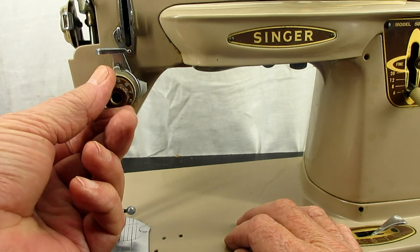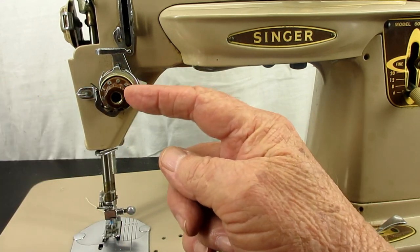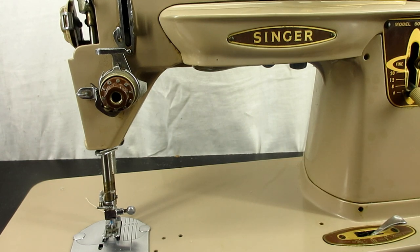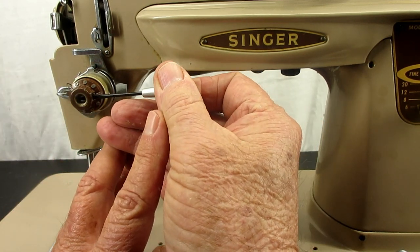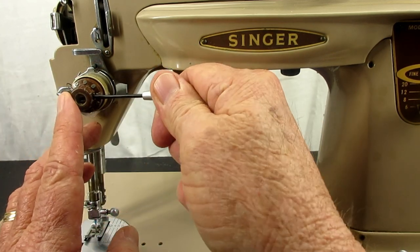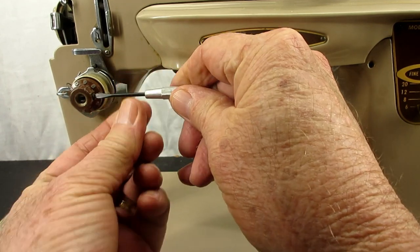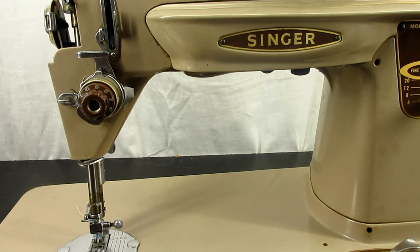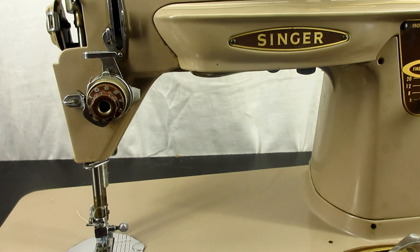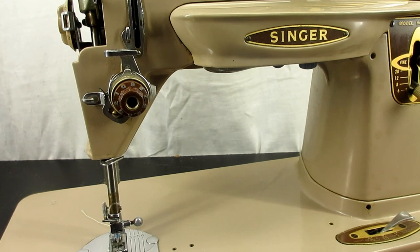If it's somewhere hard to get to, go ahead and turn the knob around until you find the little set screw. In my experience it's been at about three o'clock. Loosen it two or three turns — you don't need to take it out, just loosen it off of the flange inside. If you do take it out, protect it well because it's very easy to lose.